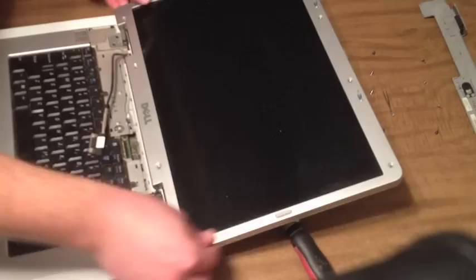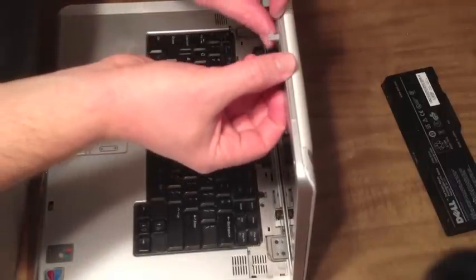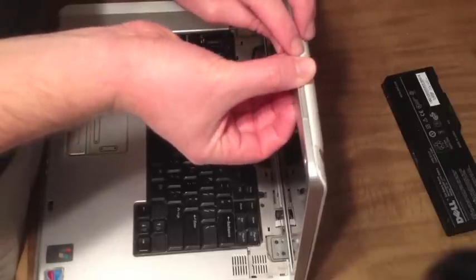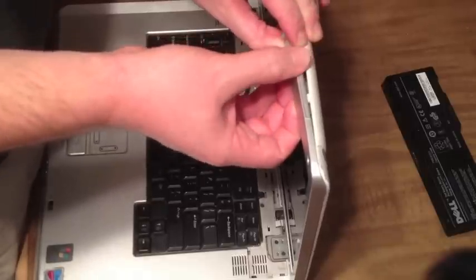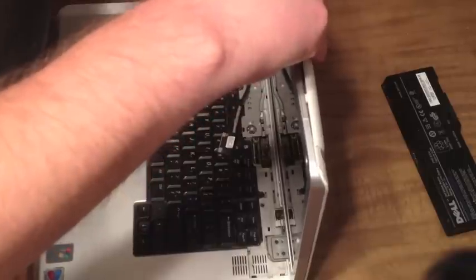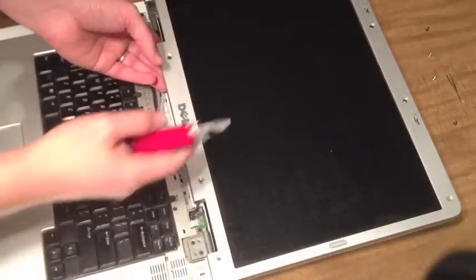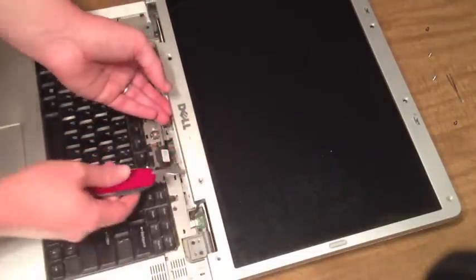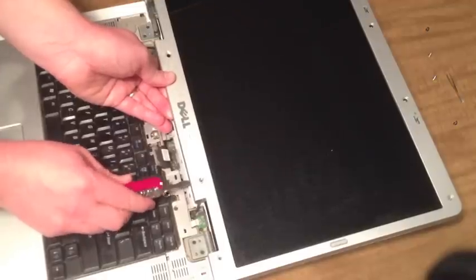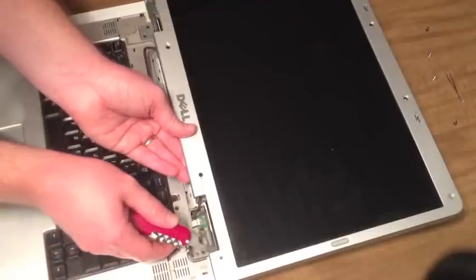And I'm going to try to get this screen edging to come off. While you're trying to remove the screen edging, it's a little hard to get it started. I discovered the easiest way is right up towards the top of the screen — if you can pry that open, there we go — and then work your way around the screen from that point, and just pop it all off. I discovered this wide, straight screwdriver blade on my Swiss Army knife works pretty well to put in here and pry up, and it doesn't seem to scratch the plastic. It seems to pop it right off.